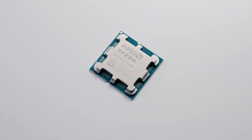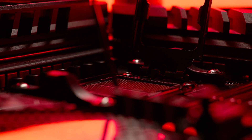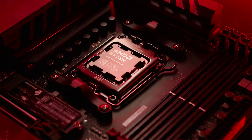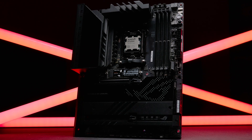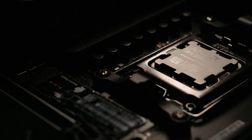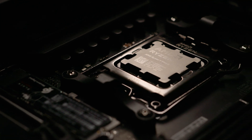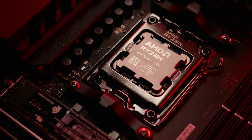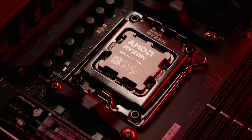In conclusion, who is this CPU for? It's for high-end gamers and professional users doing Photoshop, rendering, simulation, product design — use cases that benefit from both strong single-core and multi-core performance. It's a very good generational improvement, yielding around 12% on CPU-bottleneck benchmarks, while saving significant power and running cooler, which prolongs silicon life and gives you more cooling flexibility. You can now scale down to a 240mm AIO or even a good air cooler, whereas the previous generation really demanded a 360mm AIO or top-tier air cooling.